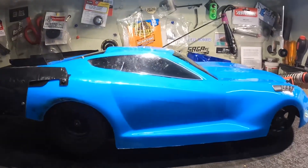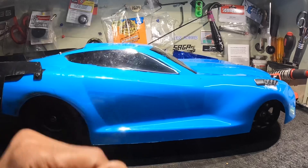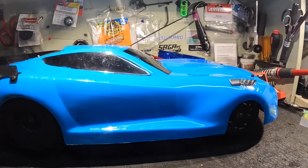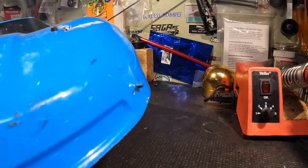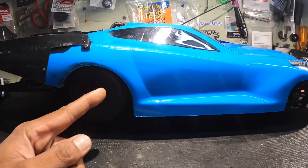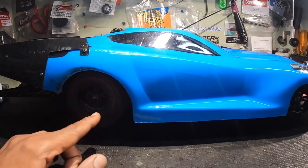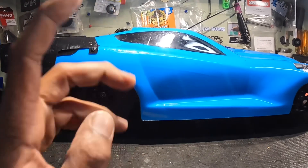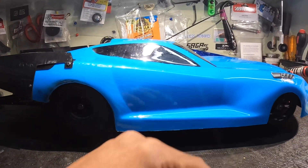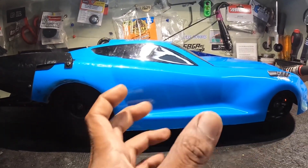Alright, bringing out a recap of the weekend races. This is the Tombstone chassis — put a body on there. I was having issues with it. Let me show y'all what happened: put a hole in there. Sunday, the first hit it spun. I was using foam, so I started using warmers. I baked the tire, cooked it, and once I put the prep on, the prep was literally bubbling. I put the car to the line and it went straight down. The problem was in the shutdown — as soon as I hit the brake the car spun out, had no control, and went straight into a cone at the end that had a brick sitting on it, and that's what put the hole in there.